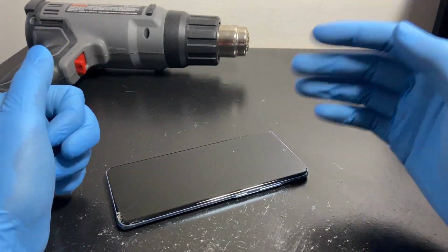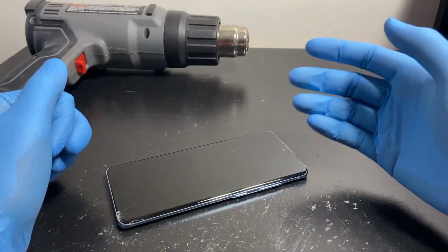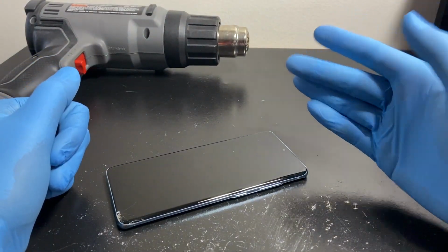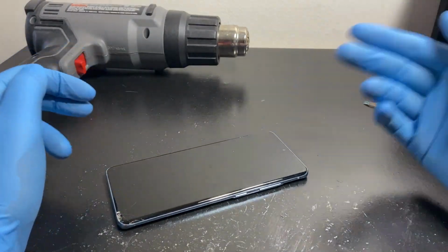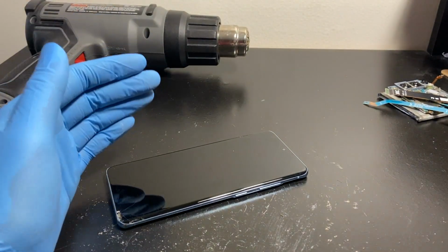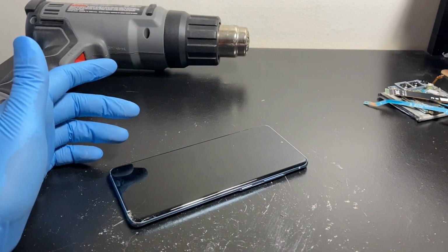I feel the phone turns on, the digitizer works, so I feel the operating system works. I flashed it with multiple versions of the supported OS using Samsung Odin, and then I tried resetting the battery, resetting the power, doing a lot of things in the first video. You can go ahead and watch it. I didn't want to extend it too far, so that's why I split it into 2 parts. I was also pretty busy.